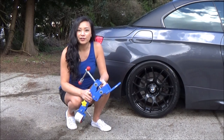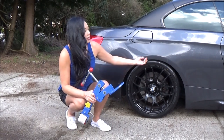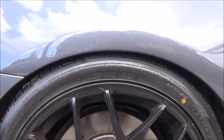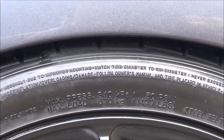Today I'll be rolling my fenders because I've got new tires and they're rubbing against the fenders just slightly when I go over bumps or if I have a passenger. I can hear my rear tires rub just a tiny bit, so I just want to flatten the inner lip by a couple millimeters for more tire clearance.